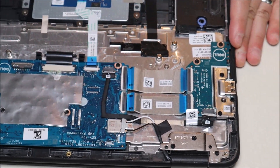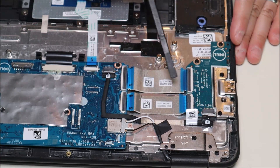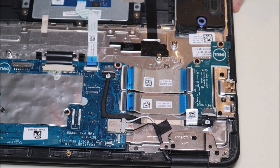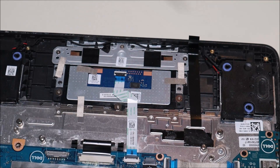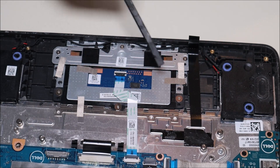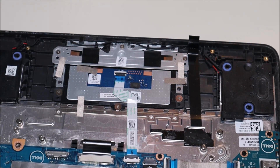As you notice, these are the same kinds of cables. So if you're looking at your USB board, you'd pop these open and slide them out just like we did with the touchpad ribbon cable. To get your touchpad out, there's a screw here, here, and here, and then a screw here, here, and here. This metal fitting on the bottom and this plastic fitting on top will have to come out, and then you can get your touchpad out.